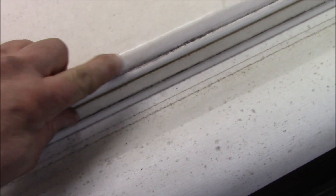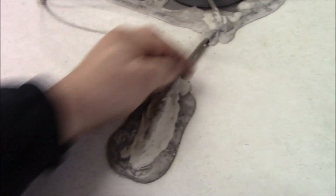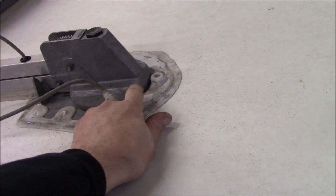On your coach, if you look right in the corner especially on EPDM rubber, it'll fracture out and you'll start seeing little slits. Those little slits are going to be chronic leaks, and those chronic leaks will get down inside the wall. On an EPDM rubber roof you'll see a fracture — it looks like tiny tiny little cracks. I call it egg-shelling because it looks a lot like when you crack a hard boiled egg. If you have one of those boot types that come down through the base, you're going to need to get that sealed — put some caulking in there and get that seal.